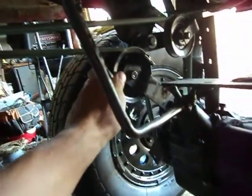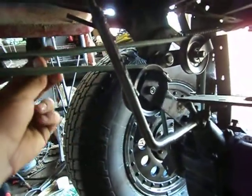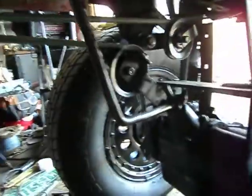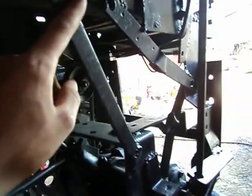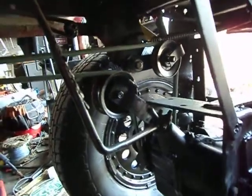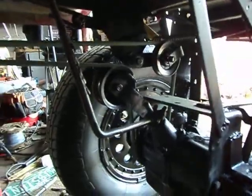And then my clutch setup — this one's stationary, this one moves, this side of the belt tightens, this one's the loose side returning to the transmission. Works pretty good. I had to build a bracket going up across here, another bracket going up, another bracket there, another bracket here. Basically, I beefed the shit out of it, because I had the thing going once I got this clutch on here — it was like a stage three stall clutch. You could put this thing in fourth gear, dump it, and it'll pull a huge wheelie and just about stall the motor. It was crazy.